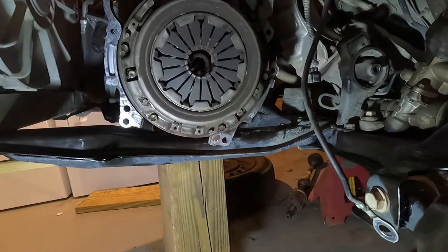One thing you might do is go ahead and get your clutch slave cylinder back in place and get your clutch line back on, then pump the clutch a few times to make sure the clutch feels correct and actually goes up and down. If you have an issue, now would be the time to take care of it. So I'm going to bolt the slave cylinder back in place, get the line connected, and pop the clutch to see what happens - just in case there's a big issue.